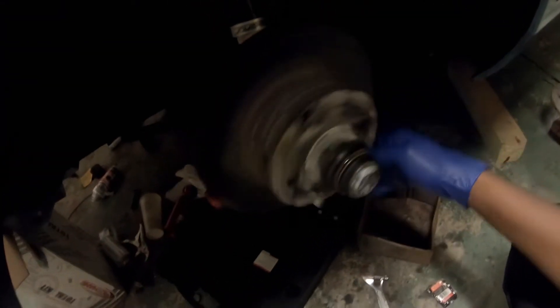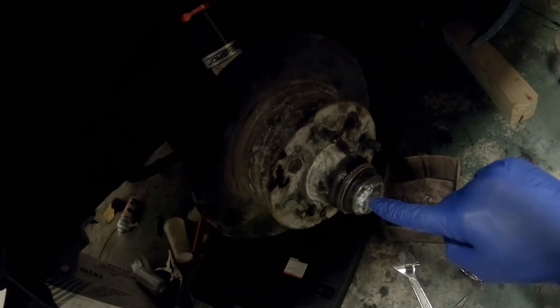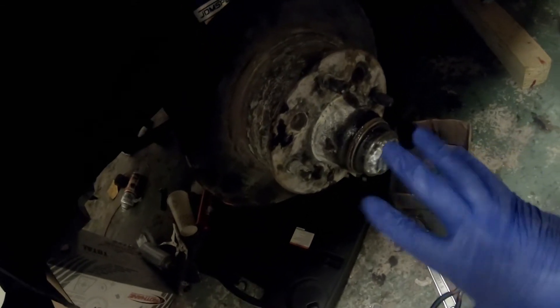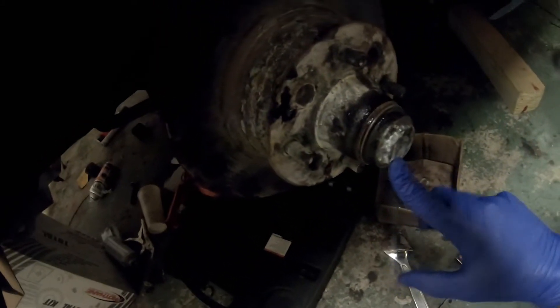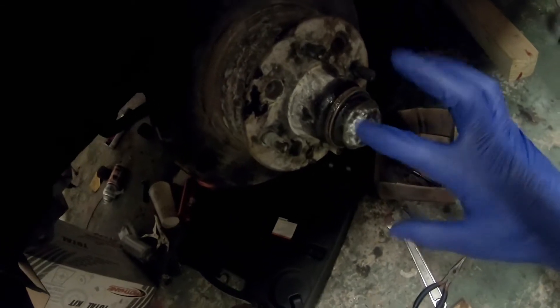It spins nice and free, I think I did a pretty good job. I'm shaking it and I don't feel anything, so that's fantastic. Thankfully I found all the bolts. The only thing is the other side doesn't have this dust cap right here, which prevents stuff from getting in there. There's a washer, a spindle nut or a tanner clip, and a cotter pin that will all keep everything together. So this dust cap doesn't do anything for keeping it all together — it just prevents crap from getting in it. I'll try to find another one of these dust caps pretty soon.